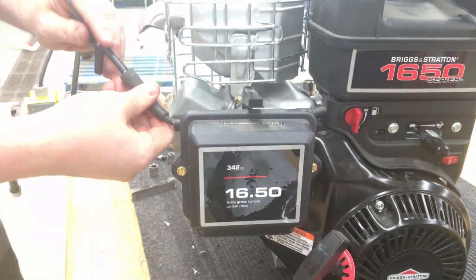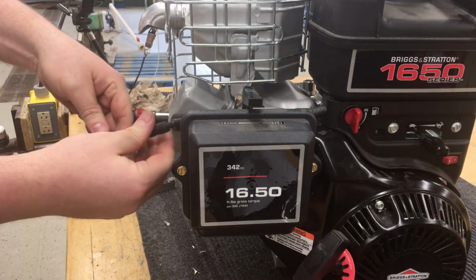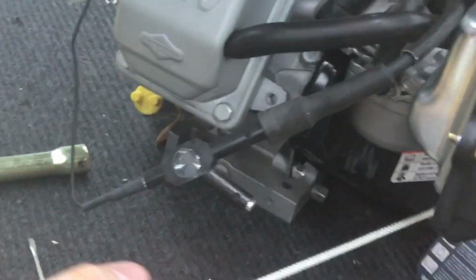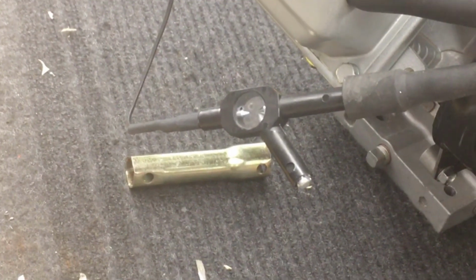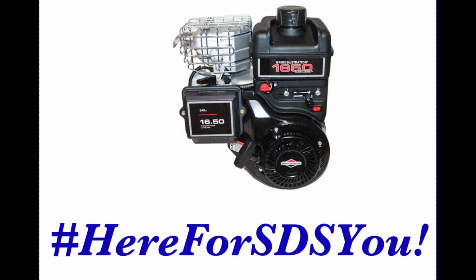And hopefully you can see it. There's a lot of movement. We recorded this a few times to try and get it, and you can just see the spark in one of the videos. But that is kind of your last test once you have the pull rope, and you can pull it fast enough as to test for spark, and then you are completed with your installation. You can go ahead, add gasoline, and do the carburetor adjustments and governor adjustments after that.